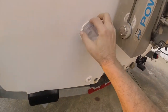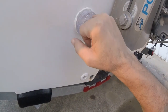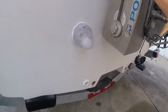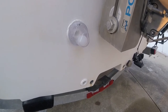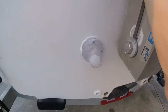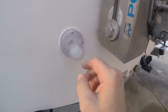What I did back here was — I saw a little crack in the sealant on the old ones, so I pulled them out and noticed just a little moisture in the wood. This does have a wooden transom — it's a 2005 Kenner. I took my pocket knife and got some of the damaged wood out of it, let it dry out, then thinned some resin with acetone to make a kind of penetrating resin and smeared it all in there real good, soaking that wood thoroughly. It was very hard.